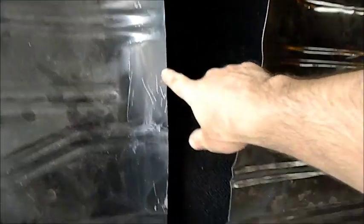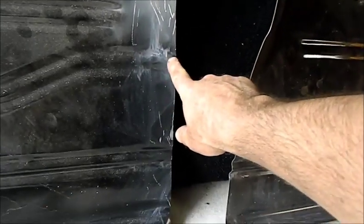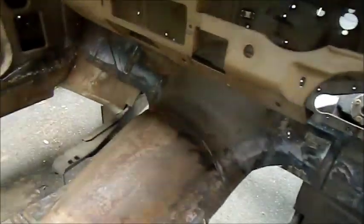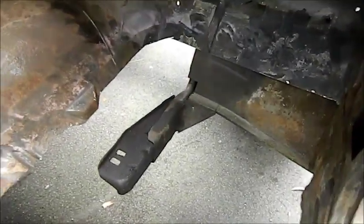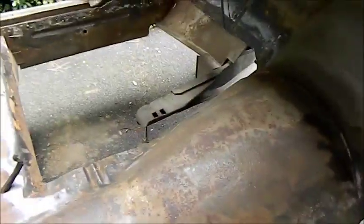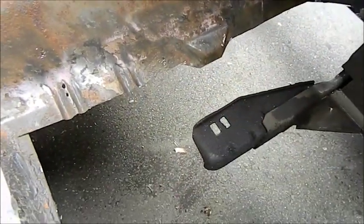Another job I can do is to put 6mm holes every inch or inch and a half apart, all around the floors, so they can be plug welded in. Until we see exactly how it can fit, the final trim on the floor pan can't be done yet. This will obviously be a bit tidier, but it was roughly cut out so I could drop the floors in and see how they were sitting.